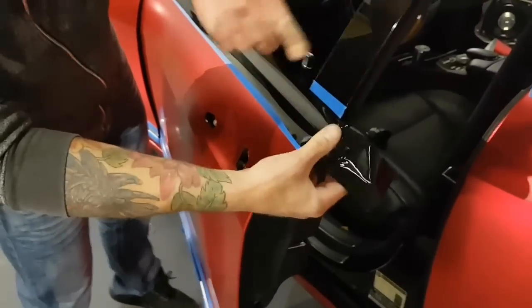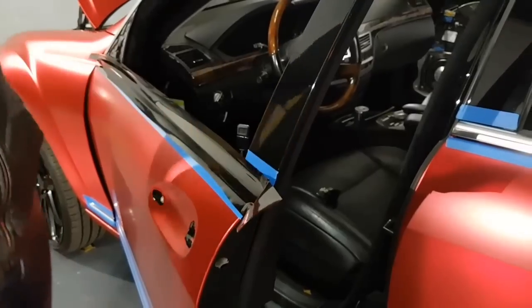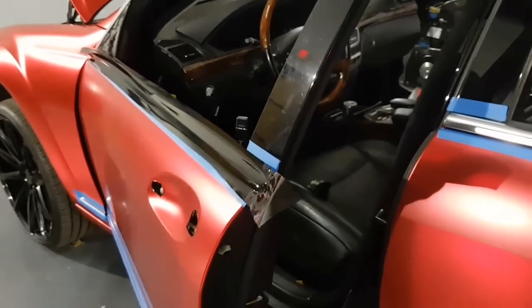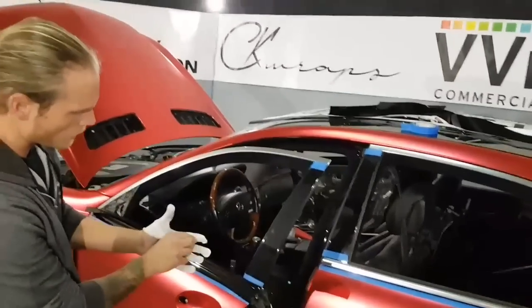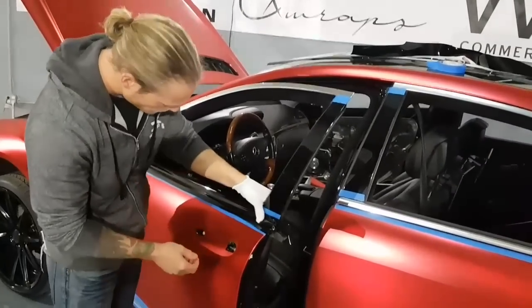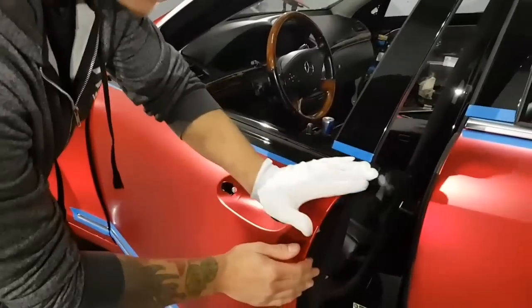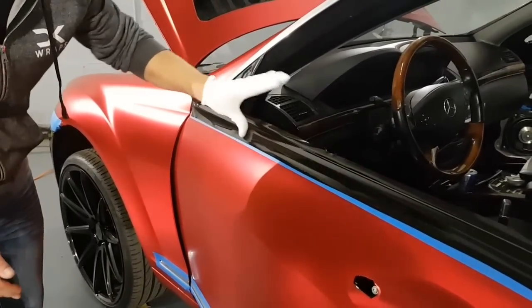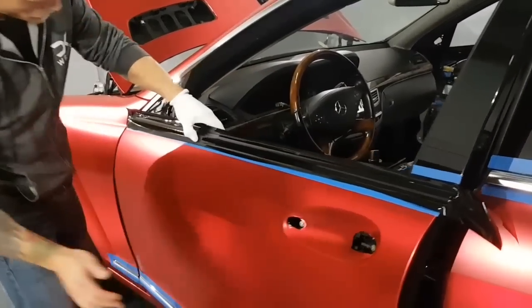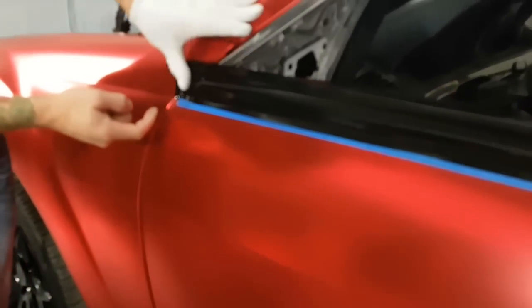Really it's just as easy to do it in two pieces — it's not a big deal, no one's going to see it. We're just doing that for full coverage, but no one's really going to see that edge once we cut this film. This is going to be laid down a lot using my fingers because they contour a little bit better to the shape of the actual trim piece. Having the masking tape on the bottom here allows the film to slide up and off of it — you can see it's kind of lifting a little bit off the masking tape, which is exactly what we want.